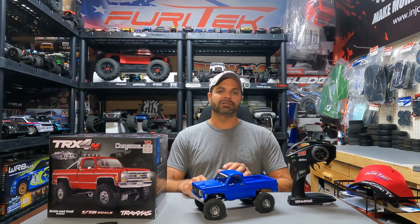Next, I think the must-have upgrade for your Traxxas TRX4M is the Fast Eddies bearing kit. It smooths these rigs out and takes a ton of that torque twist out of these rigs. Next, the INJORA 53mm shocks are absolutely fantastic. A little bit of green slime around the lower O-rings and then a 20 or 30 weight oil works absolutely perfect in these rigs. The 7-kilogram INJORA servo works fantastic and it's waterproof, so that is exactly what you want in a trail rig.